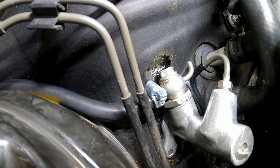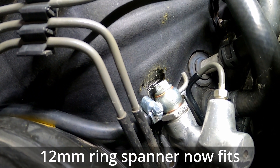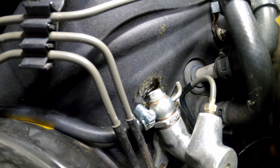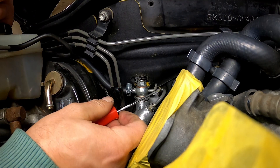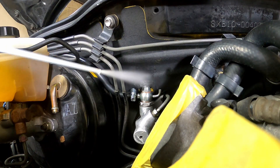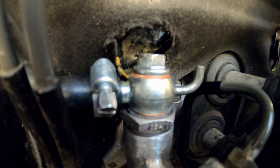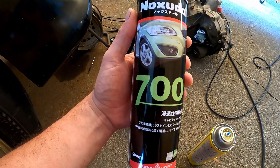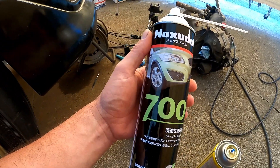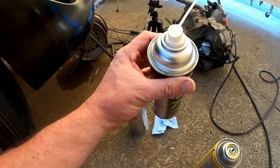For better or worse, I cut the heat shield back and jammed stuff in there and hit it with hammers to get the wall to move back. I've damaged the wall a little bit — there's a small hole about the size of a pick head that I made with a screwdriver. I put some JB Weld in the hole, let that dry, and sprayed Noxudol over the top as an anti-rust coating. I'm confident that will prevent that area from rusting.